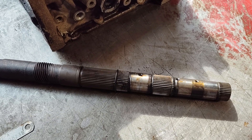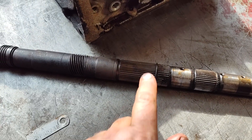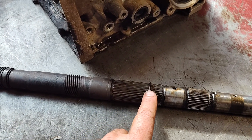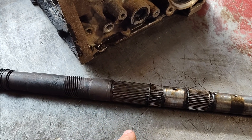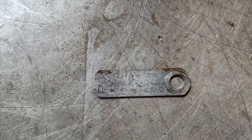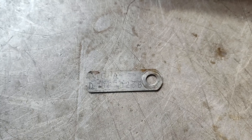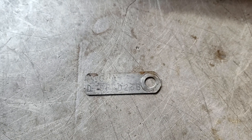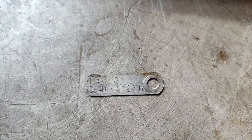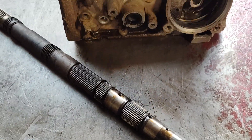I just called out a few things that were unique. On the output shaft you can see they put the clip here but they didn't put the governor sleeve — there are no governor components in it, so they just left the snap ring here and left the other stuff off. I also have the tag off the transmission, which is pretty cool. I don't know if you Ford geeks know how to decode this thing — I'm not much of a Ford man in that way. I could maybe give it a shot out of a 1970 factory Ford manual.